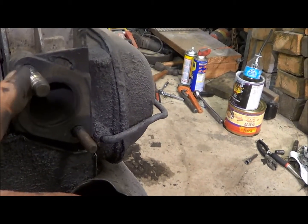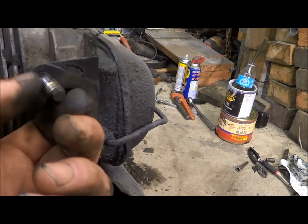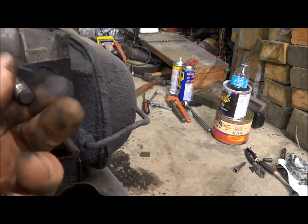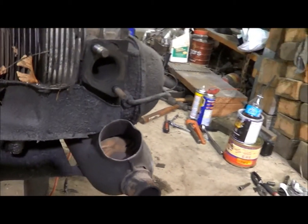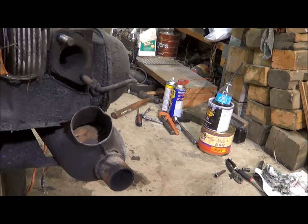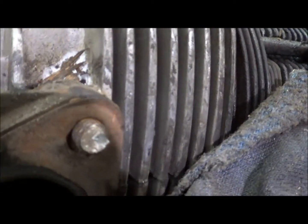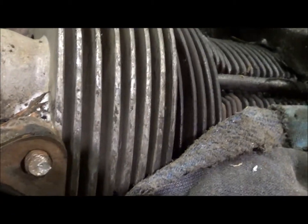This has been repaired, drilled and tapped. So I'll have to sort out a better nut to put on there. Maybe lock tight this guy in the head so it doesn't come out. But I had an exhaust leak here so I decided I better take the header off and deal with that — and don't you know it, I hate it when that happens. So I'm going to have to deal with that tomorrow.